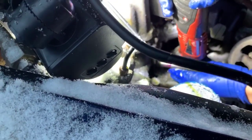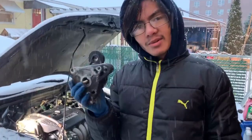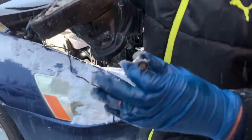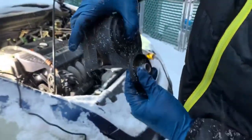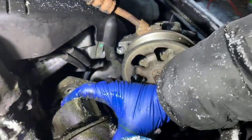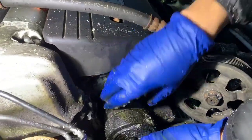That should all stick. Alright, so now we have the cover back on. Now we're going to put the tensioner mount back on. When you're putting this back on, keep in mind that there is a nut that goes on the back of the tensioner pulley. Make sure that you don't lose that — because as you may recall when we were taking it out, there was a nut that fell out and we didn't know what it did. It goes right here. So we're going to put this back on and then align it — first off I'm going to use the center bolt right here.